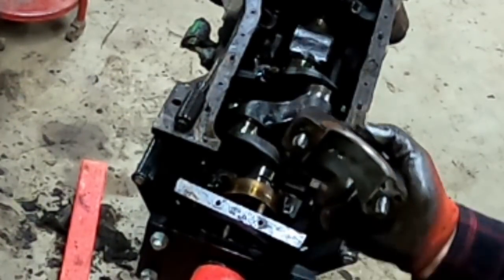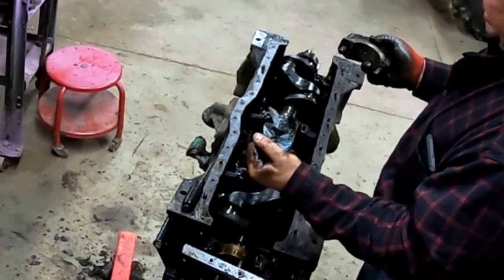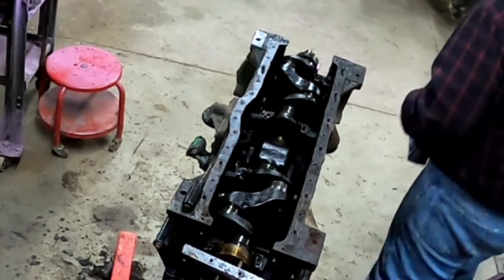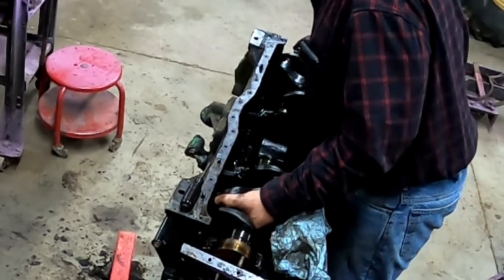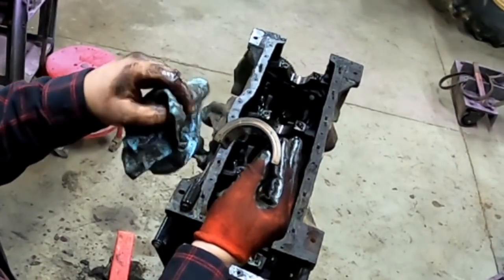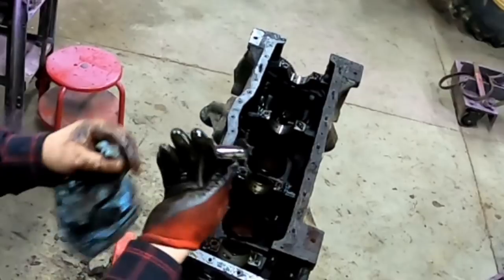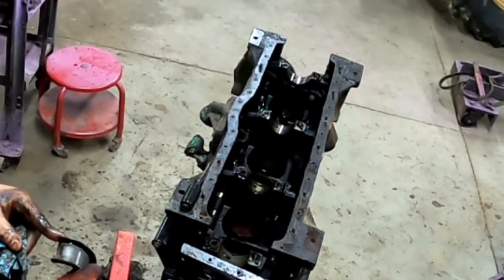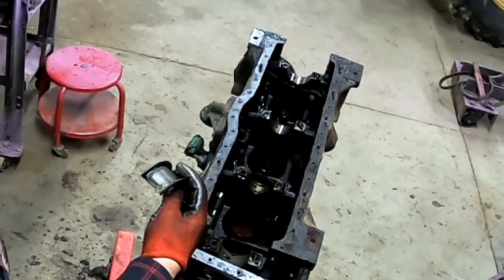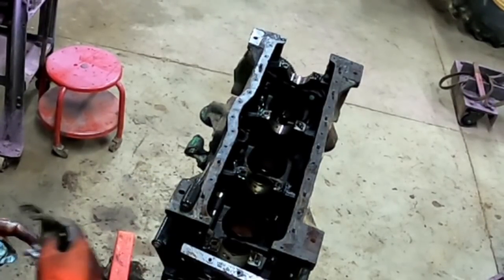So this side is basically like new, and this side could be missing 18 thousandths. That's basically good news — the crank is probably alright. With a loader on it, it's a lot of clutch work; pushing that clutch is pushing against the crankshaft, and something has to take that force — and that's this bearing right here plus the other half. Same thing on the bottom half — that oil channel is almost gone, whereas the front side is in much better shape. It has the Waukesha number: 190, 118B. No Oliver part number on this one.